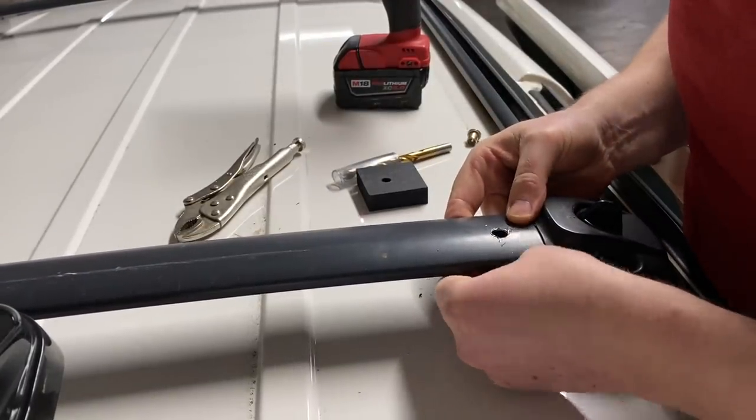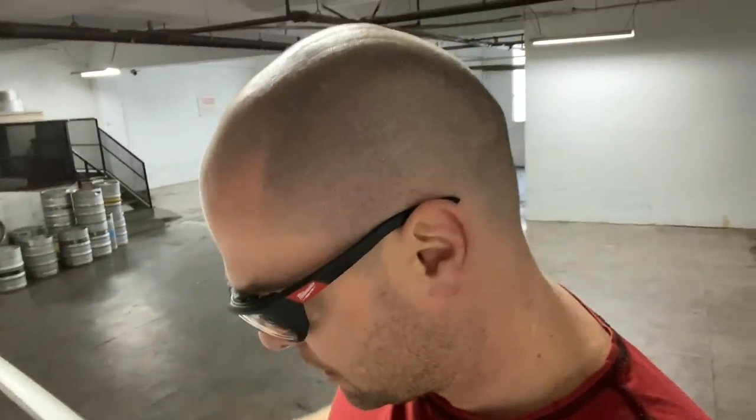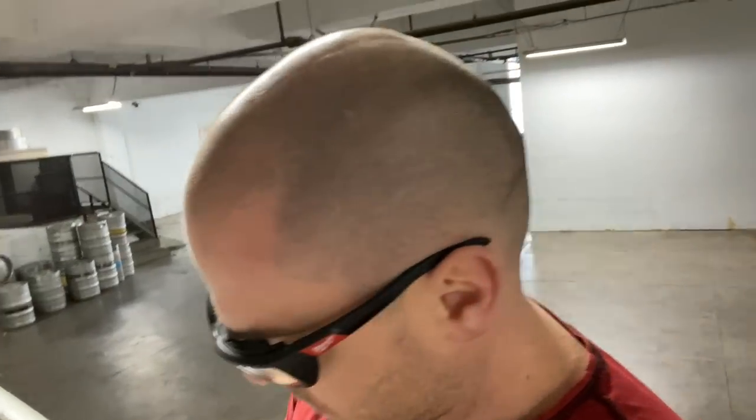Okay, I'm gonna give that a go. In a pinch, you tap. A tapping bit like this will actually work like a milling bit. It's not the best thing because the threads are actually going to catch it and move it in and out. That's why I was going up and down with it. But in a pinch, that works. So anyway, I'm going to give that a try.